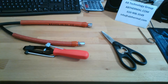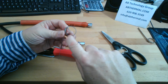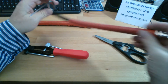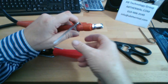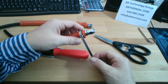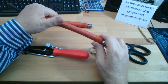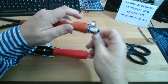I'm going to use the twice around clamp. The twice around clamp is what it says — there are two loops of stainless steel and it's a preformed clamp, so you have to be able to fit it onto the fire sleeve during assembly, or if you can remove one end from a piece of equipment. If you cannot remove the hose and you've installed a split fire sleeve with a velcro, snap fastener, or zipper, then you're going to have to use a free end clamp. The twice around clamp cannot be used.